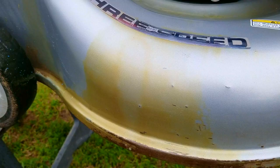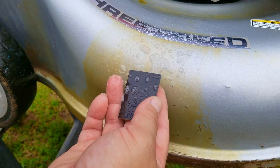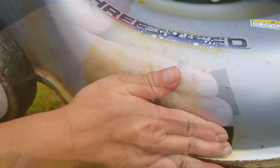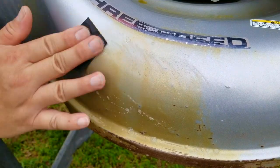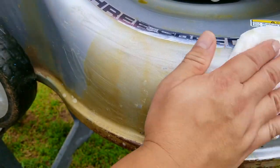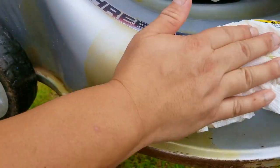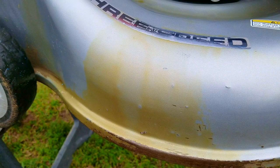At this point I really feel like taking a shortcut, so now I'm going to bring out the big guns. This is a piece of 600-grit sandpaper and I'm going to wet sand the stain with it. From what I can tell the stain is embedded in the paint and the only way to get it out is to sand it out. The only problem is I can't use the industrial degreaser while sanding because of how caustic it is to the skin, so instead I'll use soapy water. Unfortunately after wiping the soap and water off it doesn't look like I did anything to it — yet again I didn't get the results I was wanting. Here's a side-by-side comparison of the finished product versus the very beginning before any cleaning was done — it looks much better, but the fact that it's still visible after all the work makes me feel like I wasted my time and money.